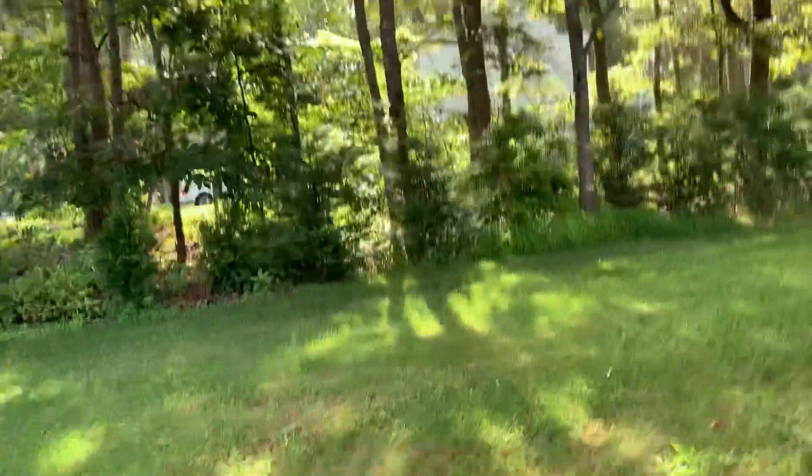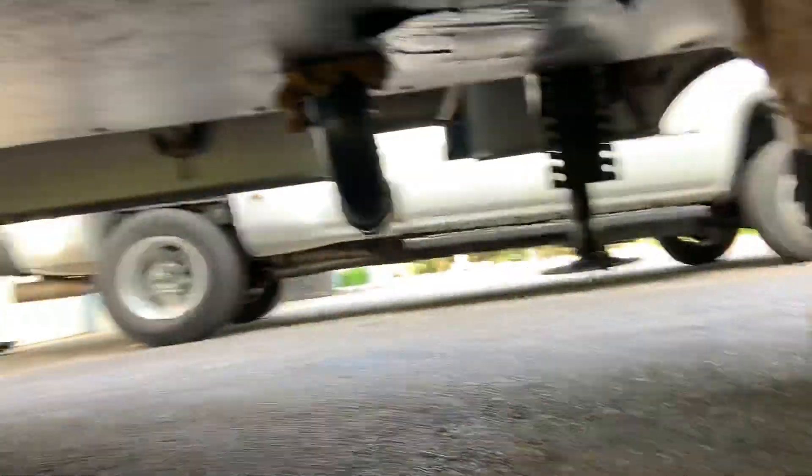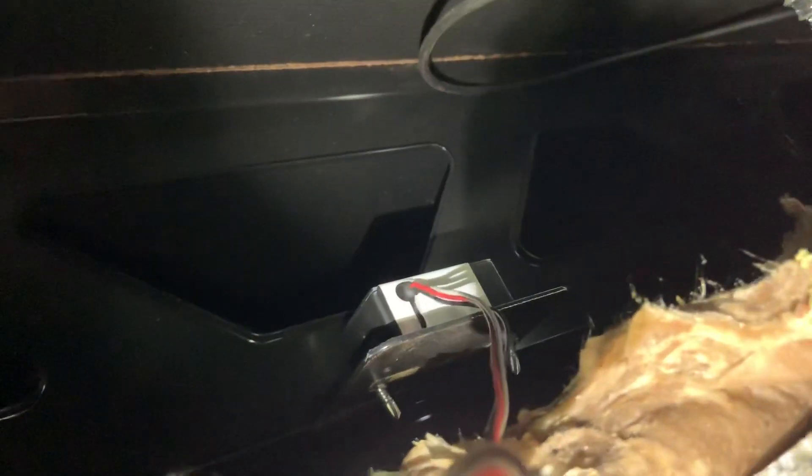Now here's the front number — it's 304-136, that's the replacement, that's the new number. If you have the old Lippert number, you're going to need that replacement. We took a five-hour trip through heavy rain and water seemed to get up into the underbelly of the camper, which stinks but it did. I found the rear sensor right away — it was about four to five feet behind the rear axle of my fifth wheel, toward the rear. I'll show you where it is — see it right there on the frame.